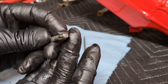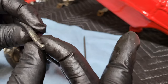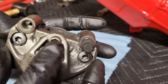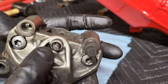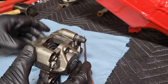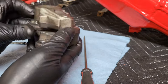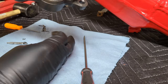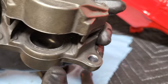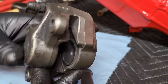Got the spring off, now there's no tension — should slide right out. You can see at the front it's got this little slip collar that wedges into that front cavity. So the pin goes in and wedges on the front side. Pin out, brake pad slides straight out the bottom. They just come right out. Now what we need to do is pull these pistons out.